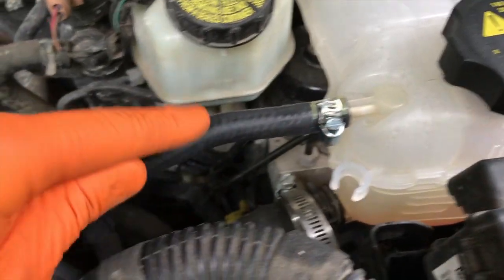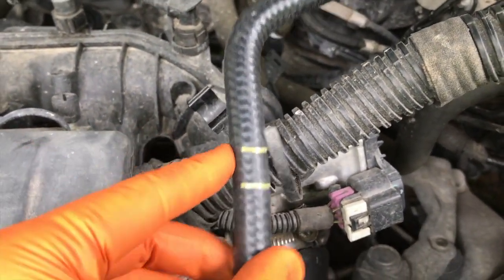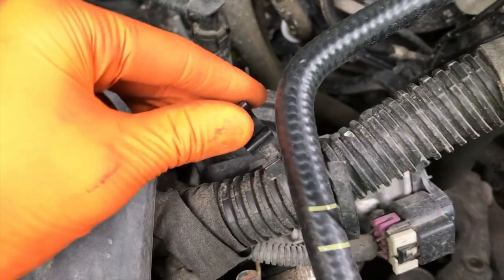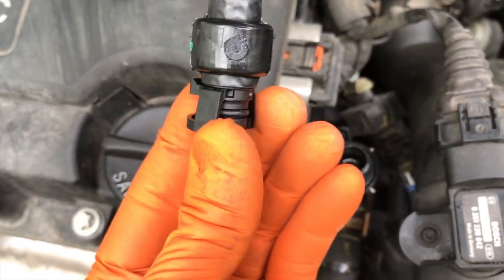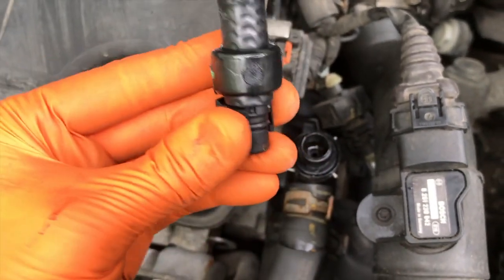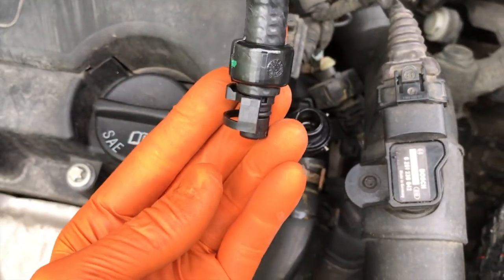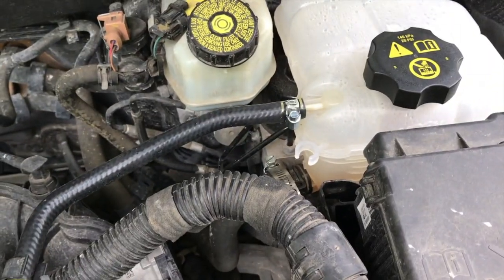Hose is secured by the clamp, following the hose down, and you've got 2 additional marks here, and that plastic connection point here. That is where those hash marks will go. Okay, that is secured. Continuing down, and that connection clip we removed off the old part, let's go ahead and carefully remove this, and do your best not to drop it inside the engine. It might be a good idea to remove this prior to actually installing that hose on the reservoir.